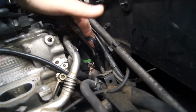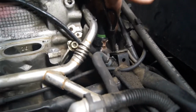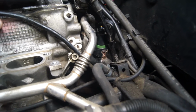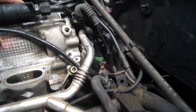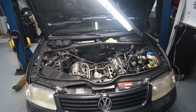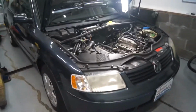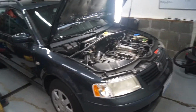The O-ring was completely gone. There's an O-ring between the sensor and the housing, and the clip was shattered, so it was just kind of sitting in there, and the corrosion was holding the water in. It's one of the higher points of the engine, so it was only leaking when it was brought up to pressure. He doesn't do much driving. He works about 2 miles away and occasionally goes here or there, but usually less than 5 miles one way each trip, so it never really got warm enough to pressure up good enough to pop that out, thankfully.